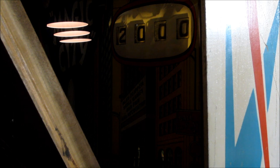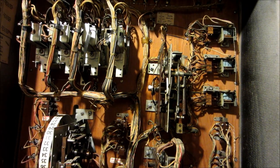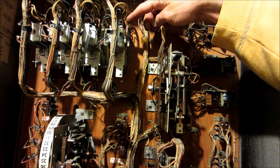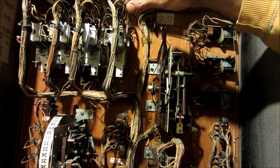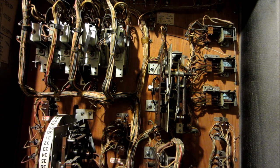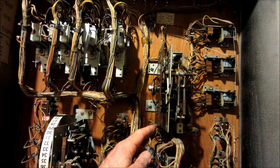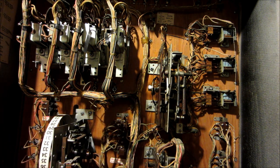Let's see if cleaning that switch got us going. I went on an odyssey on this thousand point reel - it wasn't resetting at the start, so I had to trace the wire back and it was painful. Had to follow it all the way down through here, ripped all the cat gut off as I went through. It came up into the ball count unit, and when it's in the ball zero position, the other side takes this green wire down into the playfield and out on the ball index relay. The schematic doesn't say anything about that - it says it goes to the reset relay. But I went down and looked at the ball index relay and sure enough there was a switch that was corroded, so it wasn't making any contact. I cleaned it until the ohmmeter said it was making contact - let's see what happens.